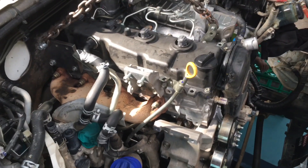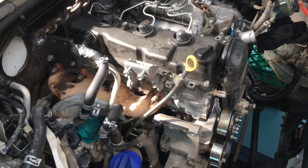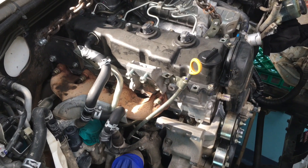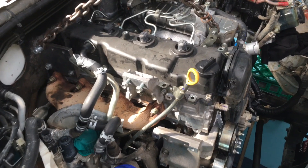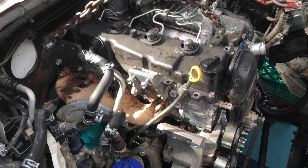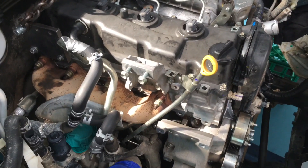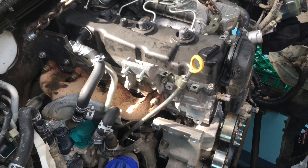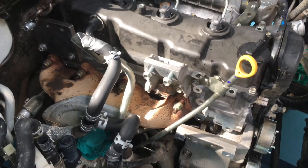It's been the case where people have made the mistake of putting the engine and transmission together, bolting it up, and creating pressure on the torque converter because it wasn't sitting in the correct position. You've got to make sure the torque converter is pushed in correctly — people have damaged transmissions from that. I'm not sure of the full story, I'd have to ask, but it's worth knowing.